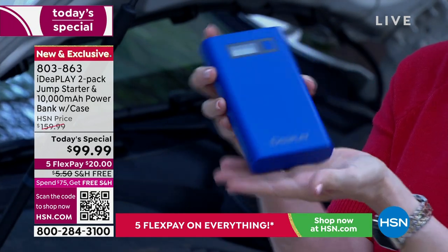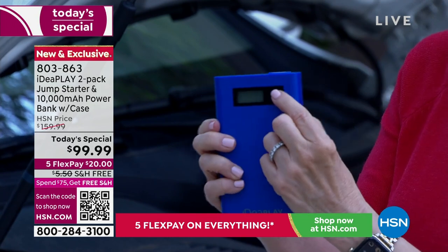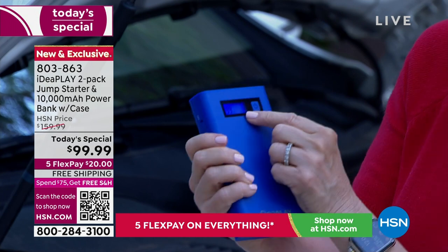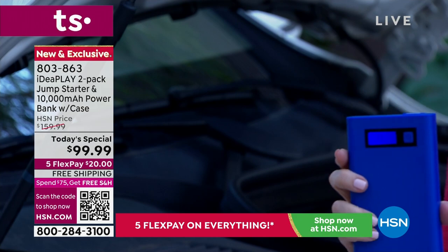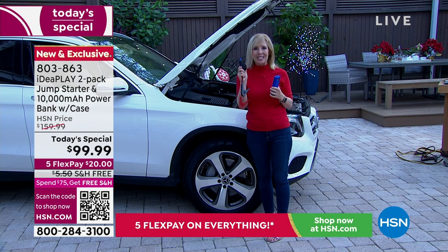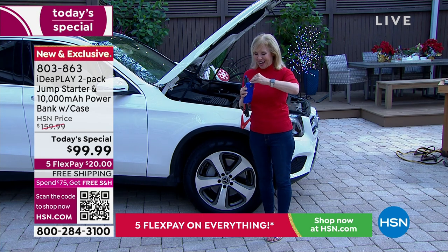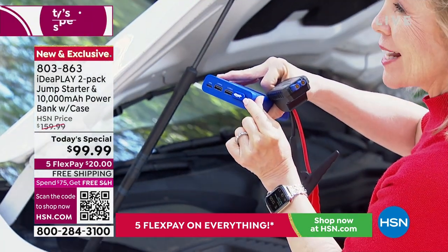With this, you can see it fits in the palm of my hand — it's nice and small. When you turn it on, all you have to do is push the button right there. It tells you how much battery power you have, so there's no guessing. We're at 99%, and I'm going to show you how you can jumpstart your car in less than a minute. It comes with mini jumper cables, and the great thing is you cannot mess it up. If you did it wrong, there are no sparks. It has an audible beep and tells you that you're doing it wrong. On the top, there's a little picture of a car — you open that up, and the cables only fit in one way.